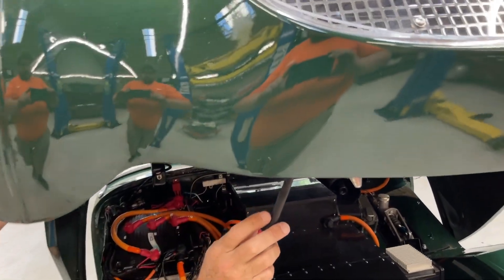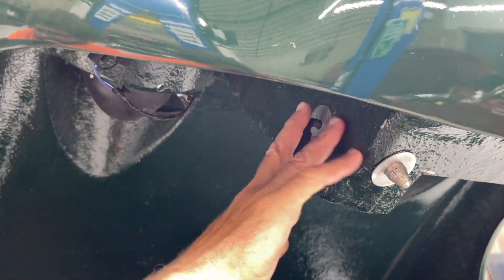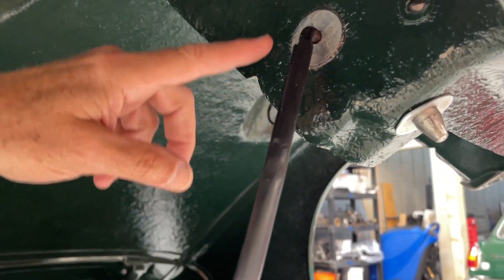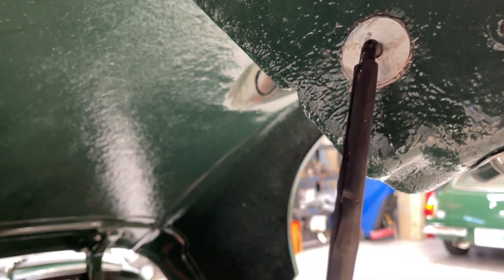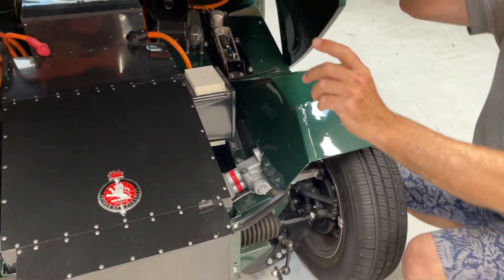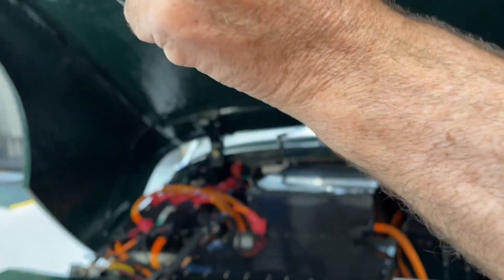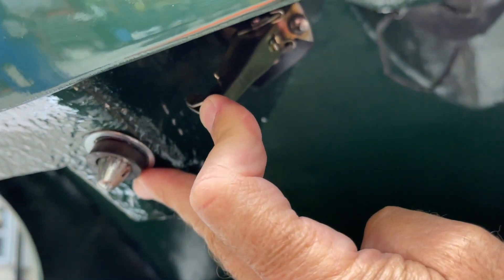The other thing is the bonnet prop. This is a fiberglass nose and it has no telescopic struts like on a steel nose. So we have this bonnet strut right here plugged into this hole — you may want to come towards me a little so you can see where that punches into the bonnet. That's how you hold the bonnet up. And then on the other side, we have this safety catch right here, and this is actually very, very important — spring loaded.